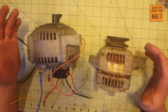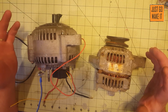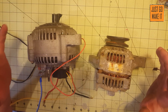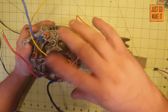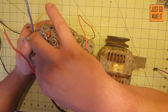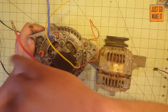So what do you have to do to the alternator itself? Some of this I'm not going to get super in-depth with because it will depend on your alternator, but it should basically be pretty much the same, and some of it you may have to use some imagination with. The first thing you have to do is the back of the alternator — strip everything off of it. There'll be a set of diodes on it and the regulator, and in the middle there is a set of brushes. The set of brushes should come off on their own. What you want to do is strip everything off down to your individual wire connections.